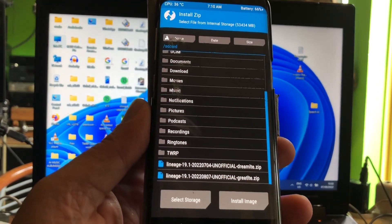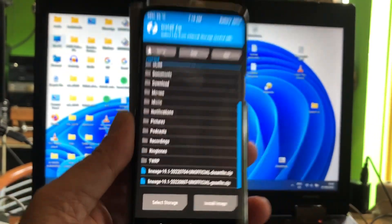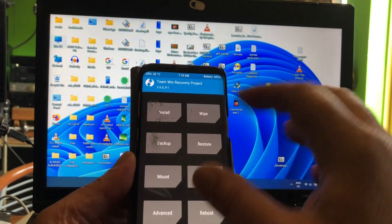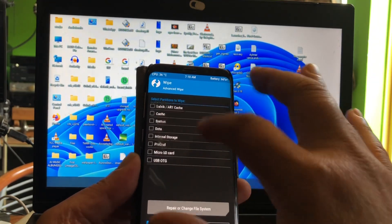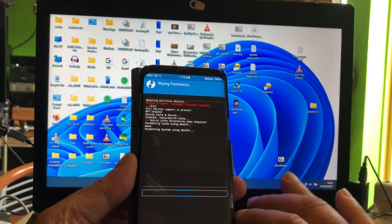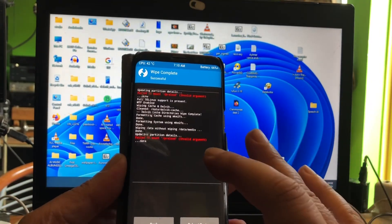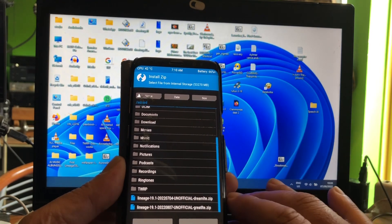Let me see if I already copied it. There it is — LineageOS released on the 7th of August. You can see the previous build on top of it. Let's do a normal wipe. If you come from the Samsung ROM you will have to do format data. I'm just going to do a normal wipe — system, data, cache and Dalvik. So I'm cleaning up this phone now. The red lines that you see, don't worry about them.